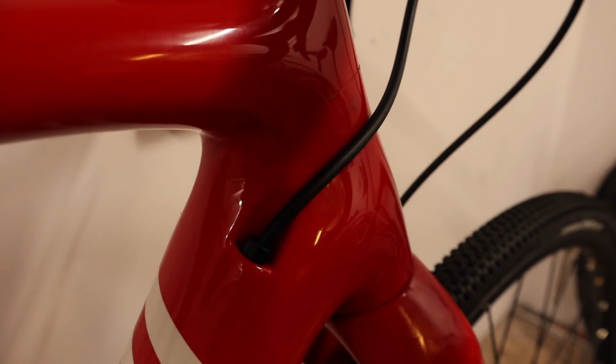But as I sort of expected, this being an internally routed bike with the caliper at kind of a weird spot versus the externally routed with the caliper at not a weird spot on a different bike, the hose would probably be too short. And that was sort of confirmed with conventional routing, the way that this should be routed where the brake line is supposed to go. Everything worked and you could have ridden it, but that's more stress than I'm willing to put into a brake hose when you're trying to steer or get around like a cyclocross course. Now that's not to say that the current routing is perfect, because it's far from perfect, but it's good enough, especially for not having spent any money to do this.